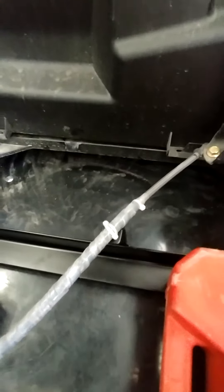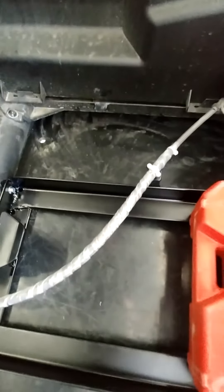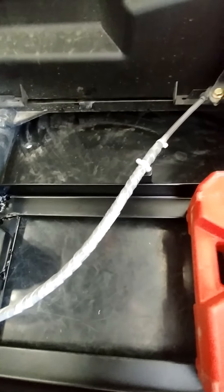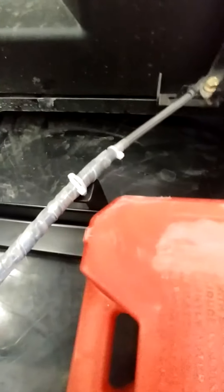I've also done a standoff bracket for the brake line. I've wrapped it in a product called F4 tape, which is a rubber-based tape that sticks to itself, plus some Teflon tape. That keeps it from chafing and also from any additional rattling.